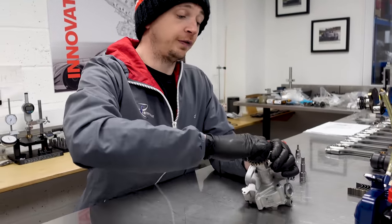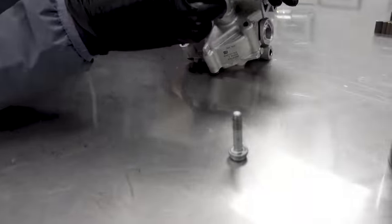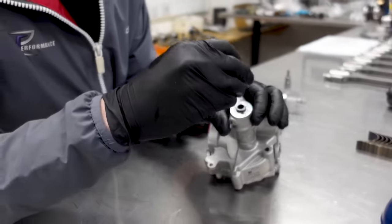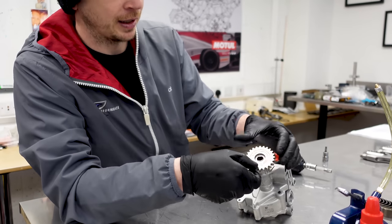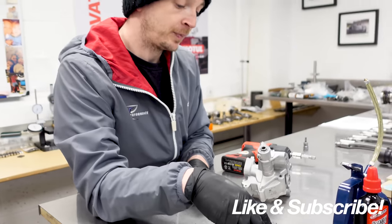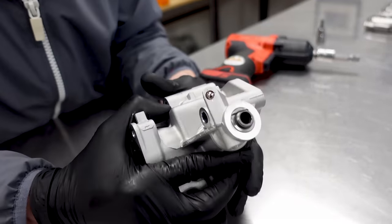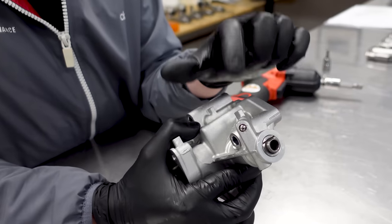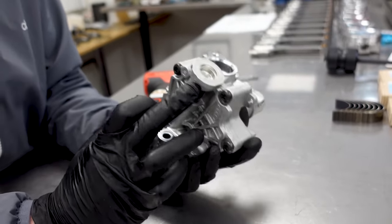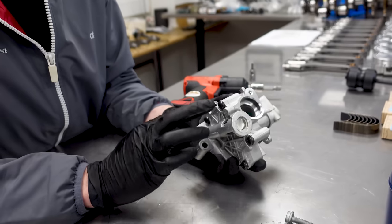The drive gear is held on with this little multi-spline bolt and it's got a flat. Very, very important you get that on and tight. You just need to make sure you get that on torqued right, and you can see there's like crap in the bottom of the thread so make sure it's perfect. There's an oil gallery blocked off with a port here - on a used pump we're drilling out, we'll take that ball bearing out and plug it with a dowel screw. And then you've got the pressure relief valve. On a used one, we would normally measure the depth, measure the installed height, take it out and clean it to make sure there's no debris stuck behind the bearing.